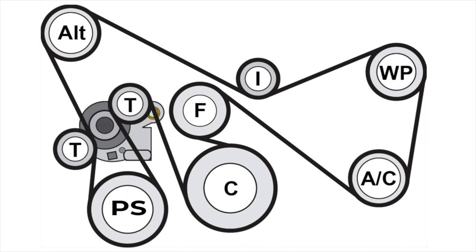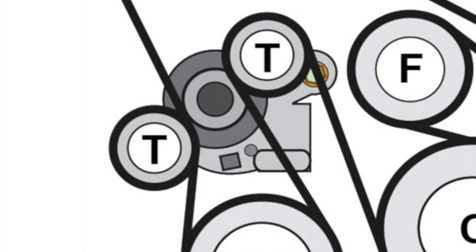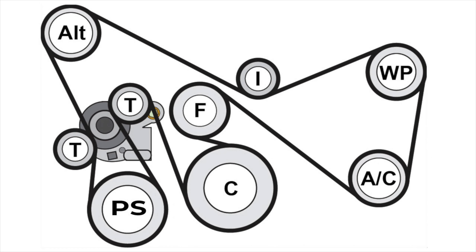We'll just zoom into the tensioner — you'll see a little square hole that's a half inch. You can use a half inch ratchet or breaker bar to tilt the tensioner and release tension. The little round hole next to it will accept a 6mm drill bit or a small podgy bar. That way you can remove the breaker bar with something in that hole and the tensioner will be locked off. You can then remove the belt, put it back on, put your breaker bar back in, take your podgy bar or drill bit out, and the tension will be reapplied. There are no torque settings needed at all.